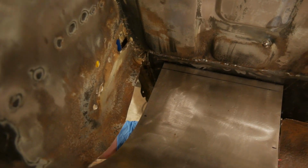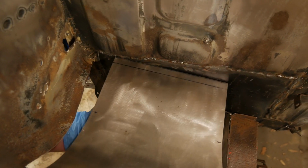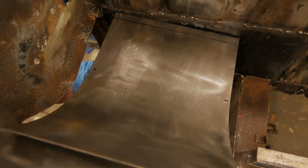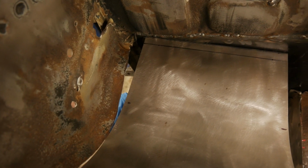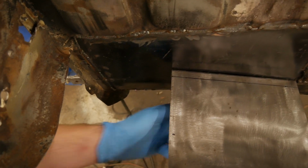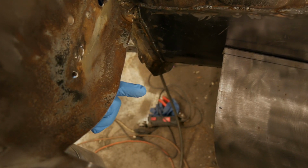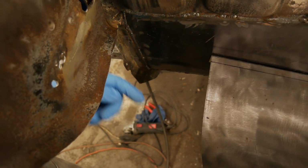The other thing we got to work out is, once this thing is level to whatever angle it's going to be, we know it's going to be angled in slightly, not that this is just kind of exaggerating, but this little corner up here, once we get everything kind of butt up to where it should be, we're going to angle it, and as you see, that gap over here closes. So we're going to have a little bit of section that we need to trim out, and you can see where I've marked right there to kind of start cutting. Basically all you do is you'll measure this gap back to where it kind of starts getting everything a little closed in and more parallel. And then you're going to cut on this panel from here up to here, this distance.